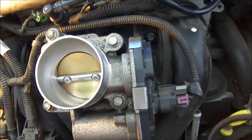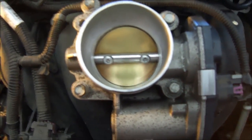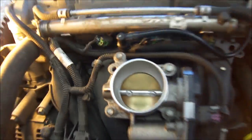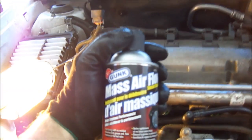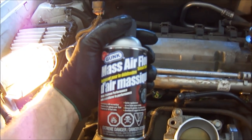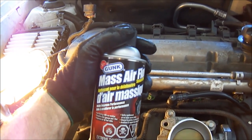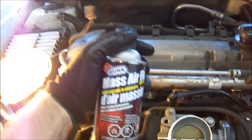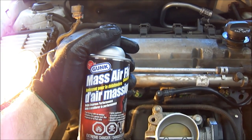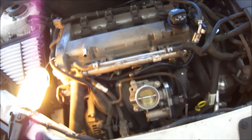When you're cleaning your MAP or your MAF sensor, just a quick little thing on that. If you're cleaning the MAF and/or MAP — mass air flow or manifold air pressure sensor — use the mass air flow cleaner. It doesn't matter if it's CRC or similar brands. Just make sure you use the right stuff. Don't use carb cleaner. Don't use throttle body cleaner — you'll actually destroy it. Use a mass air flow sensor cleaner. Unless you feel like replacing your MAP or MAF — they're about $25 to $50 each. Not in my budget.